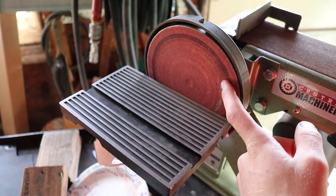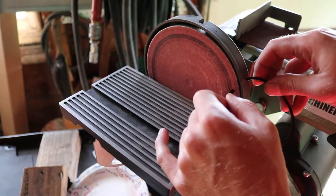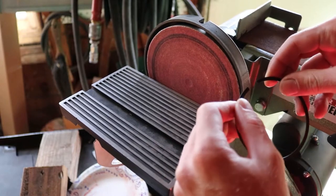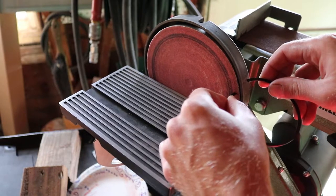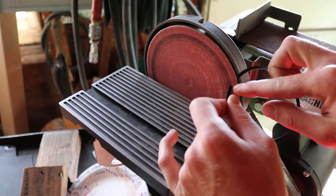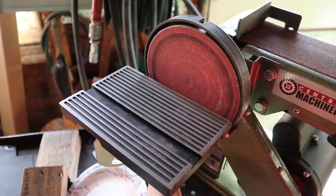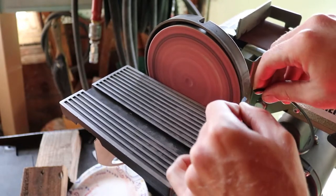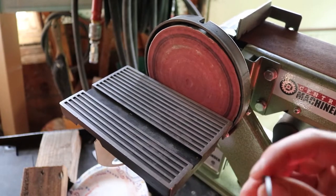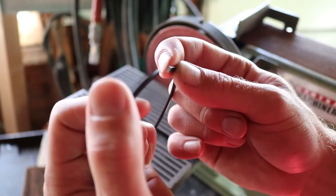All right, everybody, we are here in the shop. Got a sanding wheel here with 120 on it. What we're gonna do is I'm just gonna take this and go tap, tap, tap, and then check it. What you don't wanna do is tap it at an angle like that. You wanna make sure the ring face here, where my nail is, stays that shape. As you can tell here, that side of the ring's colored black. That side now has color on it. So take this out and remeasure.